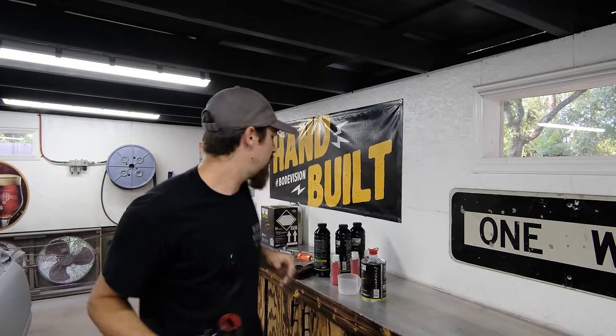And that brings me to another point that I forgot to mention. All of the holes, this is extremely important, especially for the fender and whatnot. I went ahead and I pre-threaded in all of these 10 millimeter bolts because I didn't want this bed liner to get into the holes that are going to be used. So everything for the headlight, the front bumper support, the fenders, everything that is going to be used.